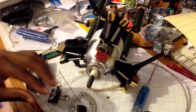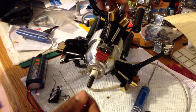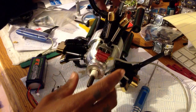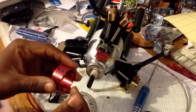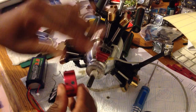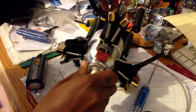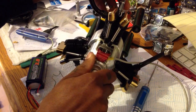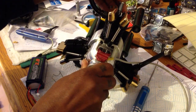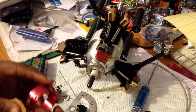I already put my sensor bracket on, so what I need to do now is find top dead center for this engine. I'm going to put my piston stop into the number one cylinder, which is this one. With this setup you only time one cylinder — only number one cylinder. So I'm rotating the prop hub to find top dead center until you can feel the piston hitting the piston stop. I think that's it right there.